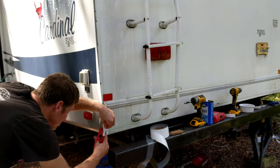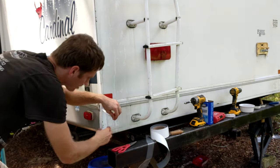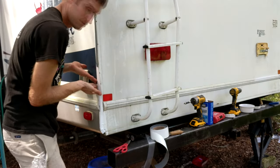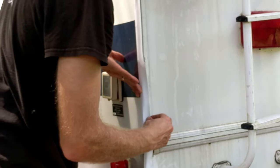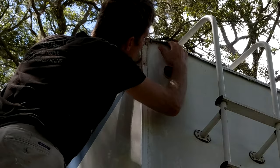These wall panels may want to bow out a little bit, so as you apply the tape, make it stick well to one side. Before you lay the tape down on the other wall panel, make sure to compress the wall panels together with a bit of pushing. Of course, you can use roofing tape to mend any cut parts that were at or under the trim that is on the roof.